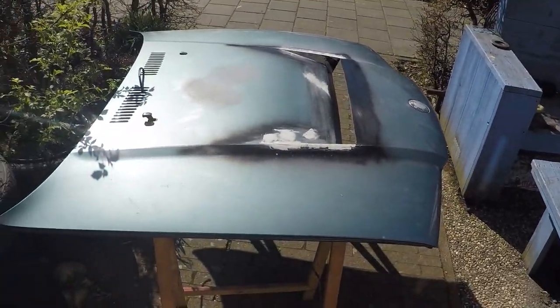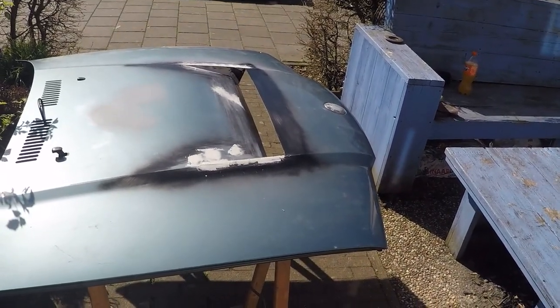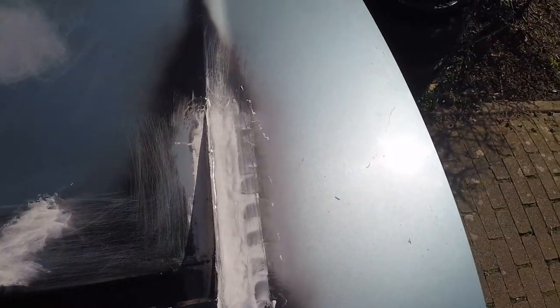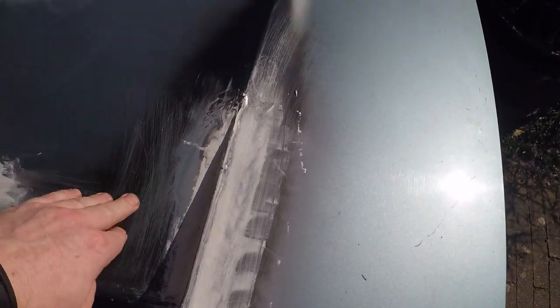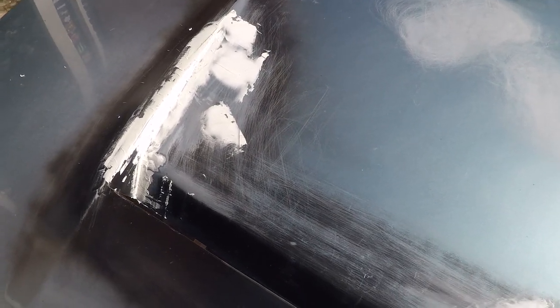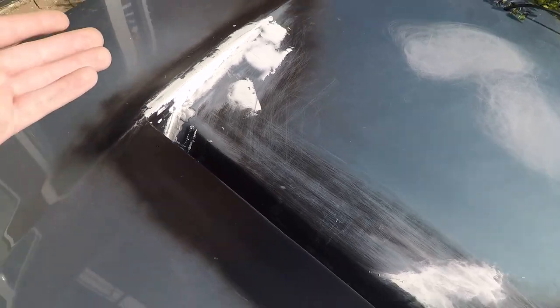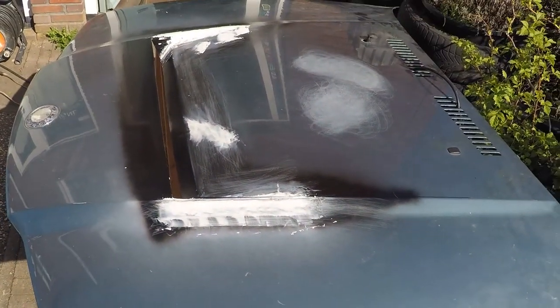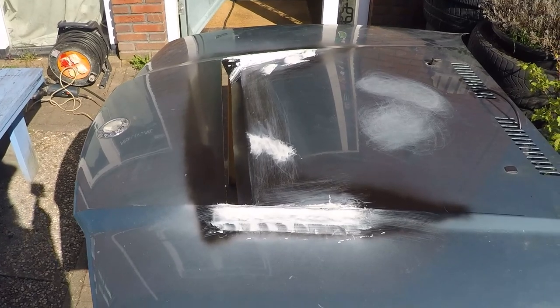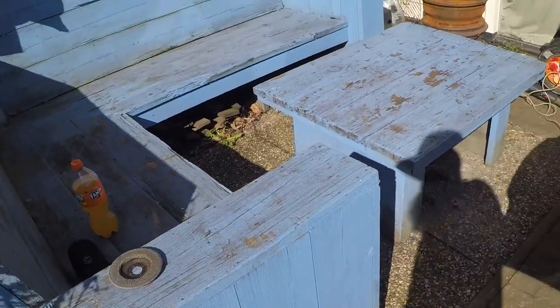So here we are with day two. I picked up the bonnet from Thomas's house and I started shaving down a few pieces - there were a little bit of welds coming through on the inner edges. I just took an angle grinder with a flappy disc and cut it just enough to clear those little droplets but still have it connected. I've just smeared some bondo on so I can make that corner nice and sealed up. I'm getting the wrap delivered today - I'm jumping the bullet and spending some extra money to do the vinyl wrap.